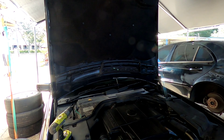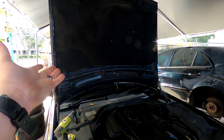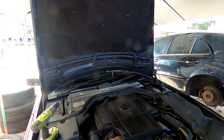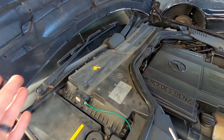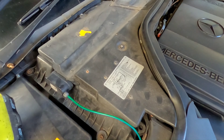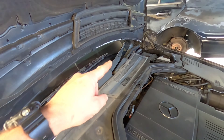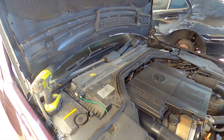The first thing you want to do before starting this project is disconnect the negative battery cable, because you are going to be accessing electrical components that could have a charge to them. Next, get your hood up. If you have a W140 like this or many Mercedes, you can open up the latch completely - there are buttons on either side. This allows you to access the back areas much easier. You'll need a Phillips screwdriver - I'm using a drill to make it easier. Access the Phillips screws here, here, and here, and one on the other end. Then pop off this line here using a flathead screwdriver.